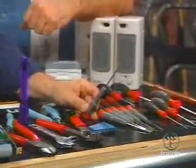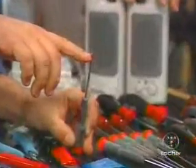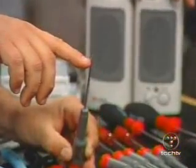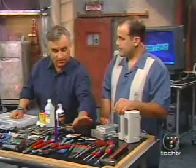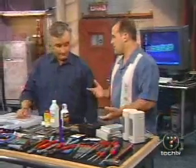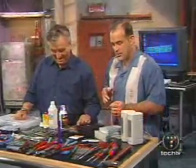On Macintoshes, this is what you need to get into the Mac. They don't use standard screws — they use Torx heads. It varies with the model of Macintosh too, so you can't just get one Torx. Remember in the old Mac classics, you needed a T10 Torx that was 18 inches long, which most of us welded together ourselves.